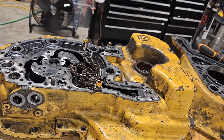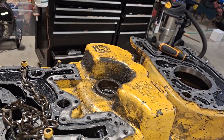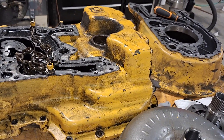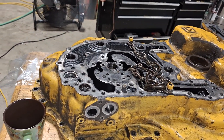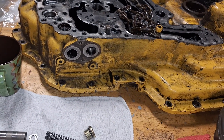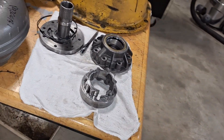It's a ZF transmission — they make transmissions for everything. It's a German company, and I drive Volkswagen diesels and like them, so I'm surprised they'd put something inaccessible like that on there. This whole transmission has about nine solenoids operating clutch packs, the front wheel drive, the differential lock, the parking brake — everything's hydraulic. The filter is only good for about 300 PSI, so if the pump outlet goes through the oil filter, you'd think the filter would blow before the pump would break. The main reason for changing pumps on these is usually low pressure at around 10,000 hours, not a broken pump.